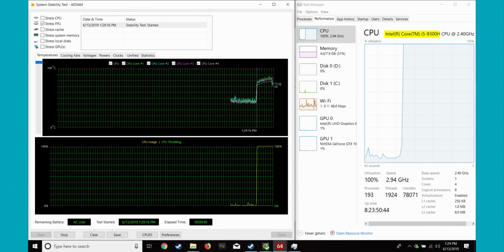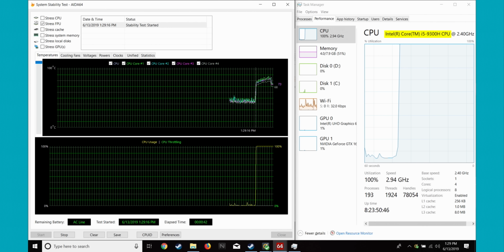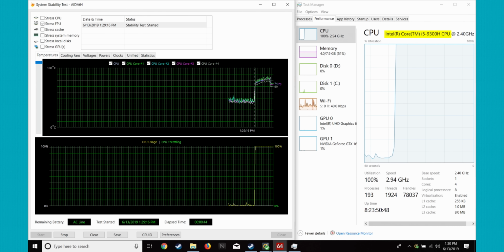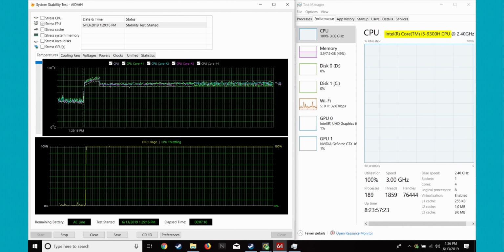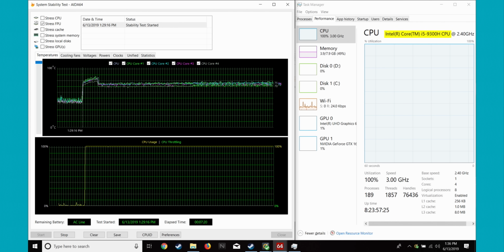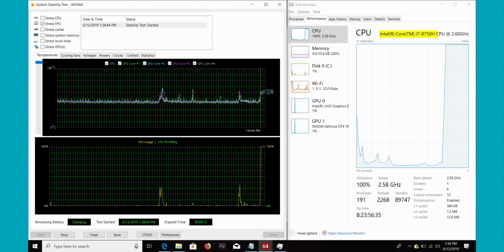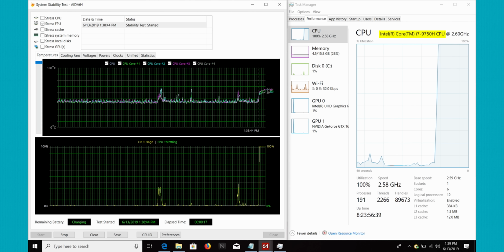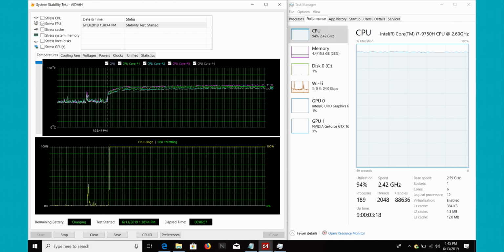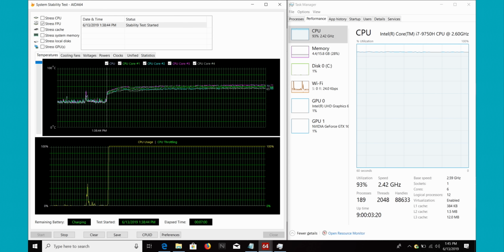So we checked it out. The i5 processor in our Nitro 5 was very well behaved. It turboed up to about 4 GHz, settling in at 3 GHz on all 4 cores. That is well above base clock. But the i7 model was actually pretty disappointing. When we put it under an all-core load, the thermals were fine, but it immediately ran up against a power limit and settled in below its base clock at 2.4 gigahertz when hit with a demanding load.